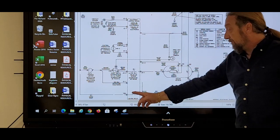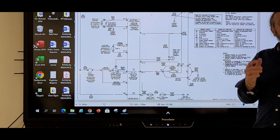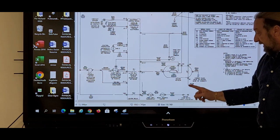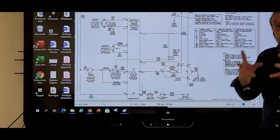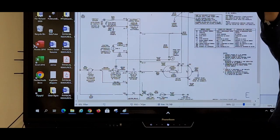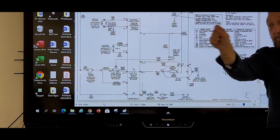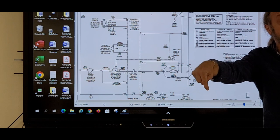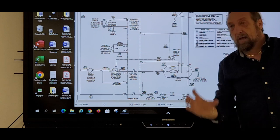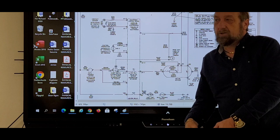Just like this dryer, I don't know if it's a relay on the board for that heating element or the element itself. But could I put my voltmeter on the two wires of the element? Let's say that this wire is connected again. Can I put my voltmeter here with alligator clips? Clip them on, get my hands out, plug the machine in, go into diagnostics, to the step that energizes the heater. Let it run the cycle and start that step. Hey, I got voltage. I have my amp probe around the heater. No amperage, but I have voltage. My heater's bad.